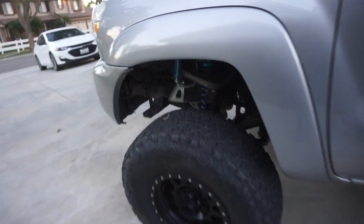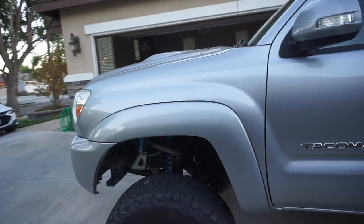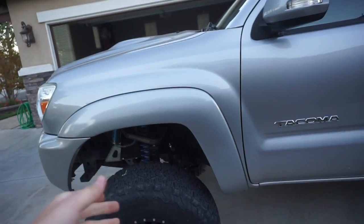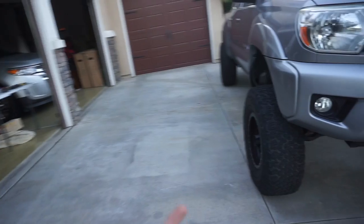The alignment is completely trashed right now. My dash light is on — I have a slip indicator light. It looks like the traction control off light but it just doesn't say off; it's just the car with two little skid marks behind it. I'm thinking it might be because of this alignment — my steering wheel is turned completely sideways 90 degrees but my truck's going forward, so the computer system's freaking out. I scheduled an alignment for tomorrow morning at LTW. I'm hoping once I get the alignment fixed, that light will go off. There's one more problem to fix, which is the ride height adjustment. They're not the same on both sides — mainly because I did one side and Tyler did the other. It's slightly higher on the passenger side. I can go back on the driver's side and raise it just a little so it's even.